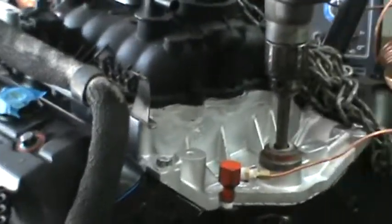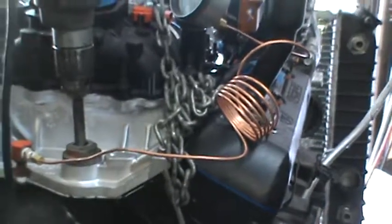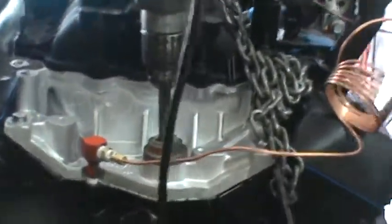Yeah, it's great, man. That's good oil pressure. I'm liking that. So, okay, we're good to go here. I'm going to go ahead and put the spark plugs in it, find out if I'm on TDC or if I'm on the exhaust stroke, or where I'm at for my spark timing. And put the sensors in it. And I think I'm going to leave this primer in there. And I'm going to prime it one more time before I crank it up.